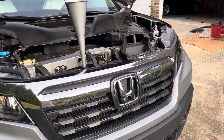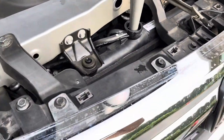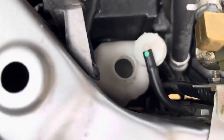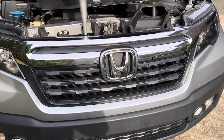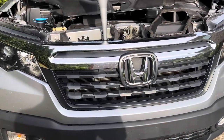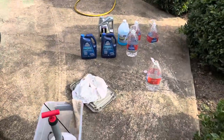All right, we're just waiting for it to heat up a little bit more. You can tell it's getting hot, the water's expanding, I can smell the heat and the steam coming. Still dripping from the recovery tank overflow. The fans will kick in here real soon and it'll start circulating this distilled water through. Then we'll drain that and put more distilled water in, to hopefully get 90 percent of the tap water out, and then we'll fill it up with antifreeze.